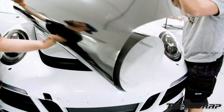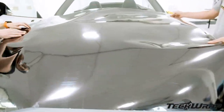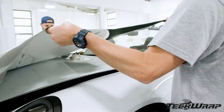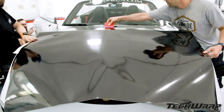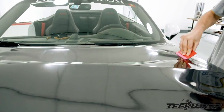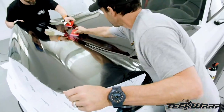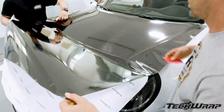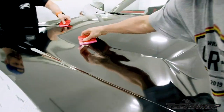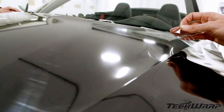The workspace temperature should be between 60 and 75 degrees Fahrenheit. Lay the panel carefully on the section and release the liner part way. Double check that the panel fits left to right and top to bottom, then lock it in place with a permanent hinge — this means squeezing from side to side on the flat area. Once set, work the film towards the sides in overlapping squeegee strokes. Continue squeezing until wrinkles start to form, and this means it's time to remove the cap sheet.